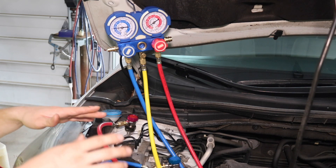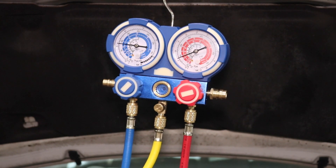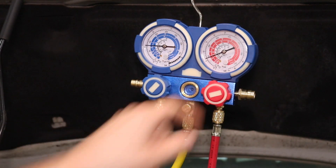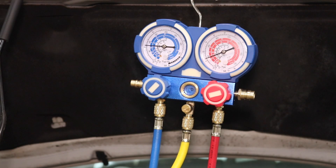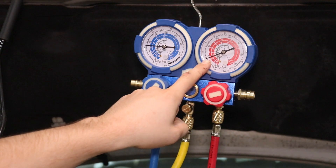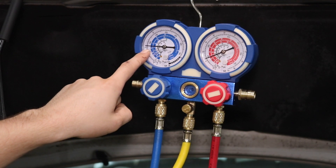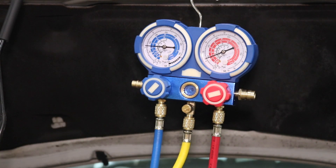Start the car and turn on the AC compressor to see what the gauges do. The AC is off — now go ahead and turn on the AC compressor. I can hear the compressor is engaged and visually confirmed it is engaged, but the high side is not rising at all. In fact, the high side is equal to the low side — about 85-90 psi on the low side and 90 psi on the high side. That compressor is not compressing the refrigerant whatsoever, which tells us we do have a bad compressor.